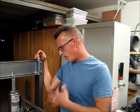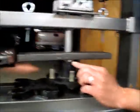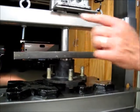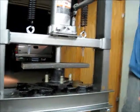We've got the workpiece on the press. The first thing we've done is set it up so that the new race goes in first. The race actually sits below this lip, so right now we're pressing it down until it's flush. Then we'll use the piece we made with the slot, which will push it further down to the stop lip inside. That's the plan.